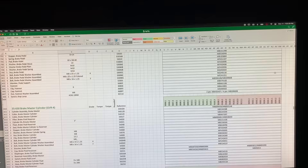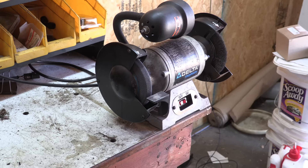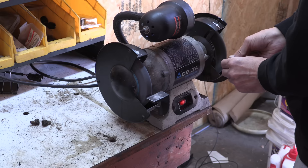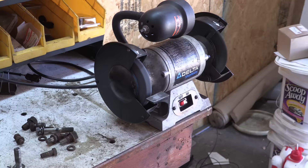To put my subframe back together, not only do I need to have all the parts clean and ready to go, I need to make sure the stuff I'm reusing is up to the task. So first, I spent countless hours in front of a wire wheel cleaning and inspecting everything I've bagged and tagged. Inspecting heads and threads, counting parts based on their dimensions and bolt grades, and then comparing how many are used across various parts groups, because many types of fasteners are used in multiple places.